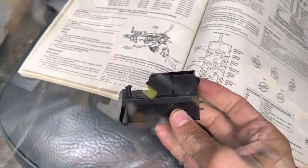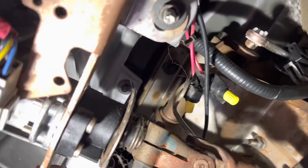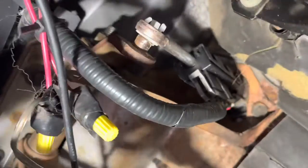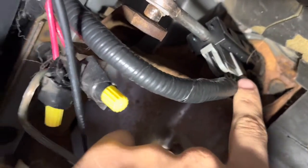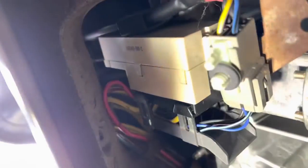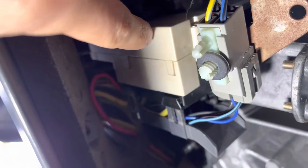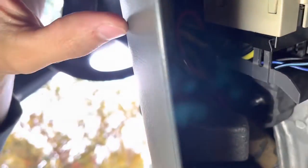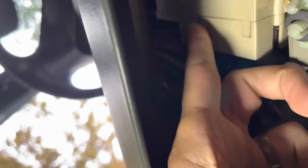But I'll show you how to replace this clutch neutral safety switch. Once you're under your dash, right here is your clutch neutral safety switch, and this white or cream-colored box here is your ignition control module. You can get to it by taking this lower dash bezel off, which is just two bolts, and then there are two more bolts here and one on the other end for the actual module itself.